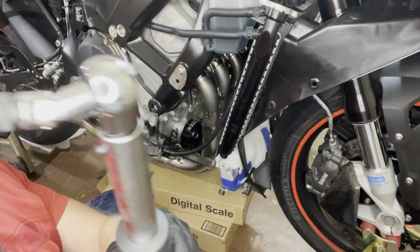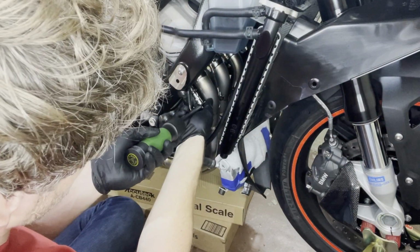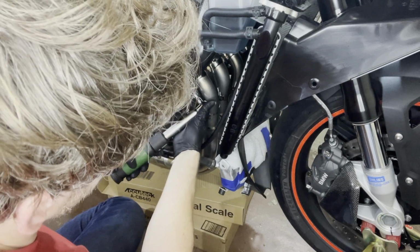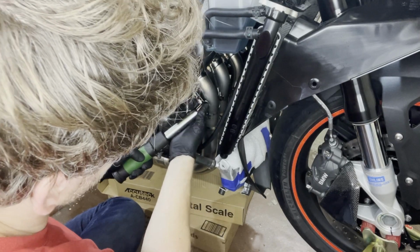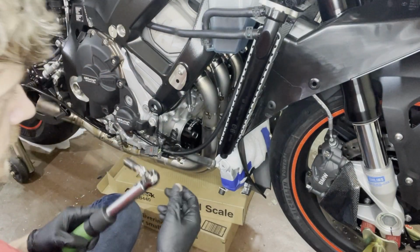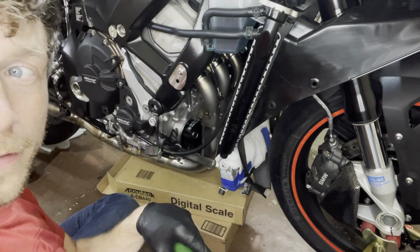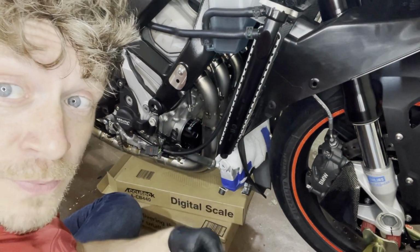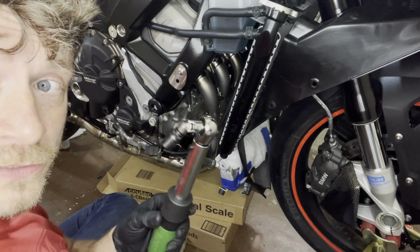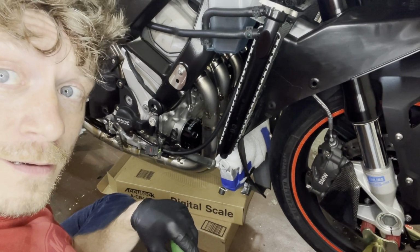So just so you can see one, I'm using my torque wrench with this little guy. So you can finagle it on, and then it doesn't take a lot. If you do it by hand, 10 Newton meters is not a lot. So this is already 10. So first one down, 3 more to go. This is the hardest part, getting the headers in and getting the springs on and torquing it down. Rest of the installation not so bad. This part kind of sucks.